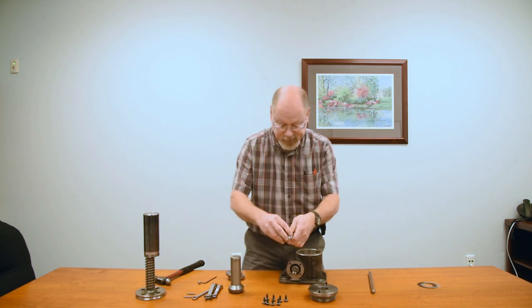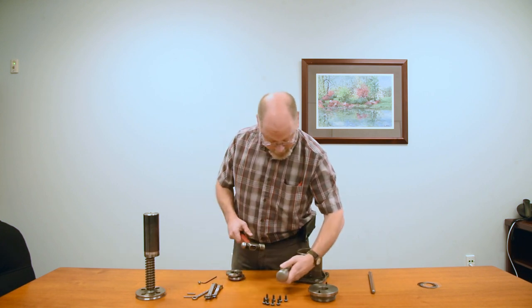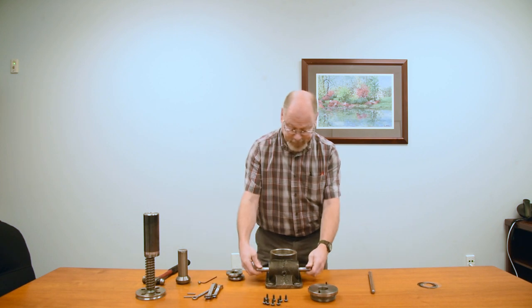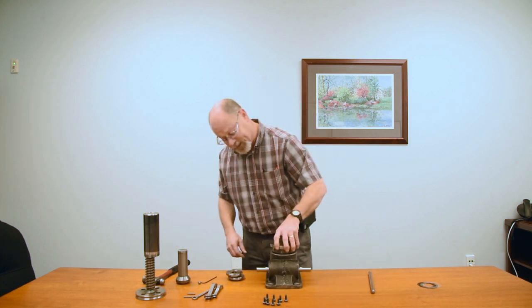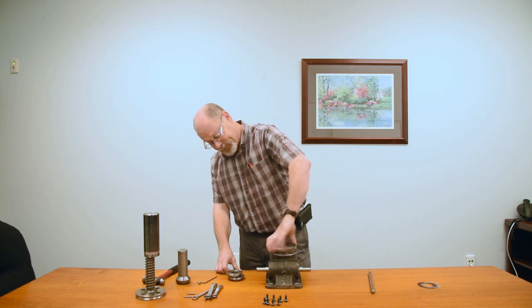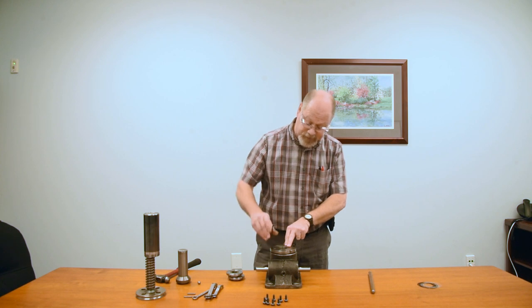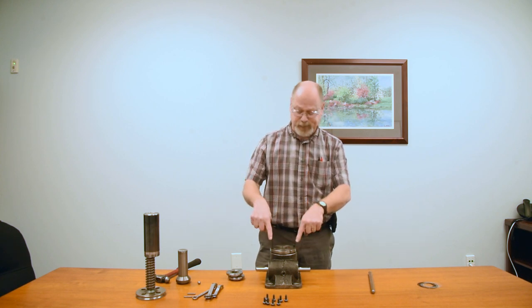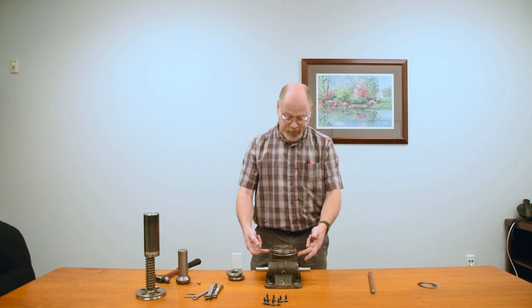It should be a little snug because it locks down and your bearings are going to roll in the race. So basically that's pretty much complete. You install your shell cap, then you lock it down with set screws. You always have set screws in the shell cap to lock it down — sometimes they're on top, sometimes they're even through the side to go in the shell cap.